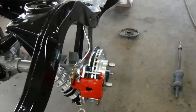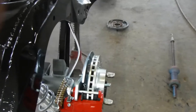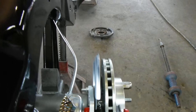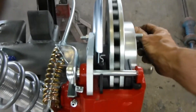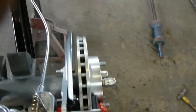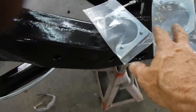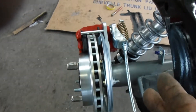In this video I want to show you how complex these brakes are and lining things up. The object is to center the shoe with the caliper. By the time you get done you should have a nice centered rotation — everything pretty well centered with enough room for the floating caliper. This is called a floating caliper. It comes with multiple shims to make sure you put everything in line.